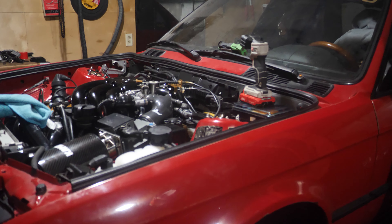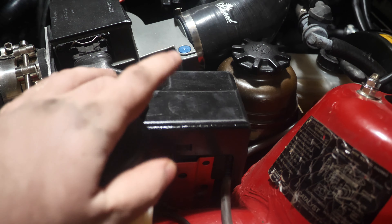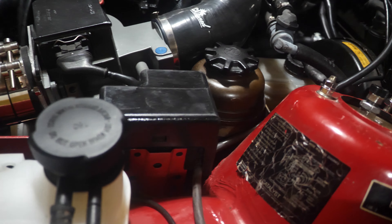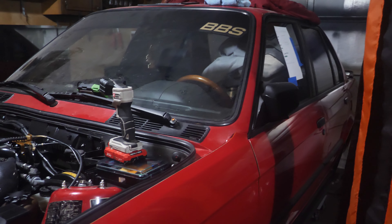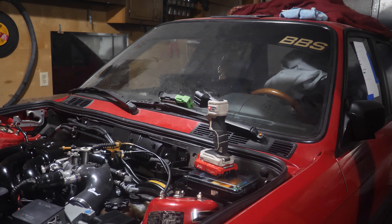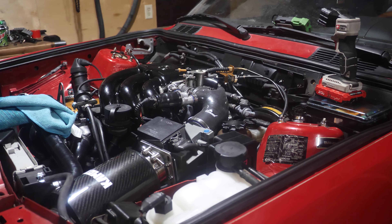So I have to figure out why the fuel pump has no power. I don't know if the fuel pump's bad, or a fuse is blown, or whatever. But what I'm thinking is this little box has the fuel pump relay in it. So I'm thinking that when I was doing all the engine bay stuff, maybe some water got in there and made the relay go bad. I'm hoping that's it. If not, I'll have to trace it down. Also for some reason, once I put the key on, the brake lights turn on like someone's stomping on the brake when no one's touching it. I did swap over those pedals from another car, so I'm not sure if maybe the brake switch on it is messed up — the cover on the outside is broken off. Maybe I'll have to get a new switch for that.